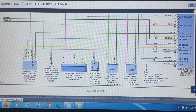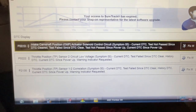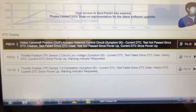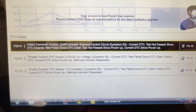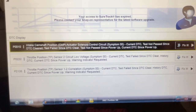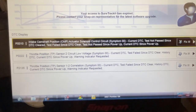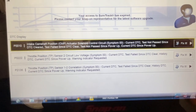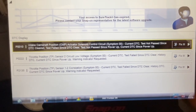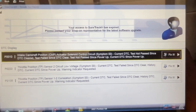Let's go to the vehicle, look at the codes, see what we have, and then after that we can verify, fix this up, and give it back to the customer. These are the codes we have: P0010 intake cam position actuator solenoid, then P0222 — that's a TPS circuit 2 — and then throttle position sensor 1 and 2 correlation. Those are our codes, so let's check this out and see what we find.